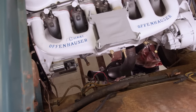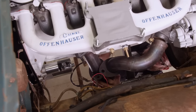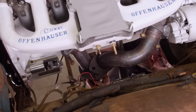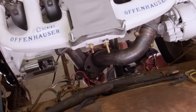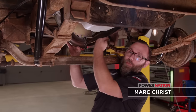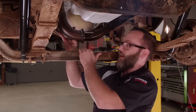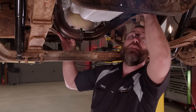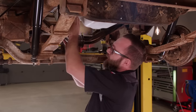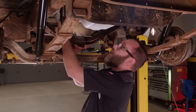One great thing about being able to take engines that were built in-house down at Engine Power and dyno is that a lot of the hard stuff is already done. Like this merge pipe on the hot side of the turbo — this 300 straight six has got two collectors, so Frankie went ahead and made this merge pipe two-into-one, three inch. But the problem is where it kicks over to go under the pan to the driver's side — it's really close to our I-beam front axle, and this front suspension is completely unloaded, so that's going to be a problem. I'm just going to modify this, turn it forward and tuck it up a little higher so these two pieces can meet right around the front of the engine.